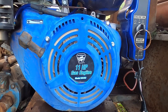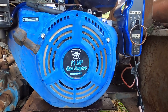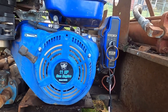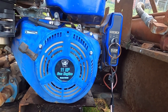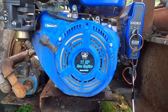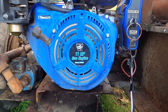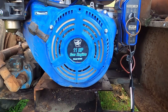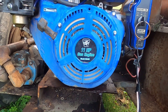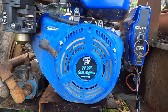On 50 PSI compression to start with — the rings were stuck. Ran it in for about five minutes, drained the oil; again for another five minutes, drained the oil again; ran it for five minutes, checked the oil — it was not anywhere near as milky. Let it run for a little while longer, checked the oil again, still not real milky, a little bit but not bad. Let it run longer, drained that oil out, put fresh oil in — the oil's good and clean. Got quite a bit of junk out of the crankcase from the rust and whatnot.